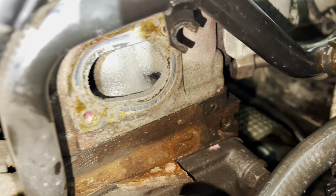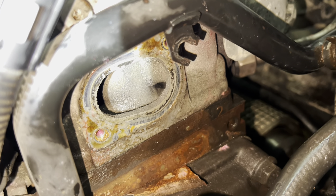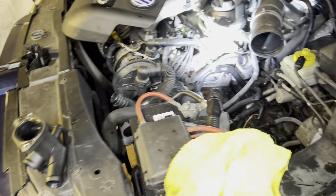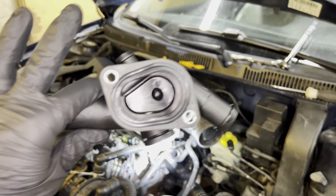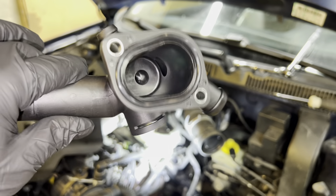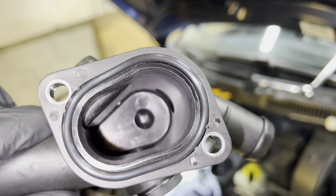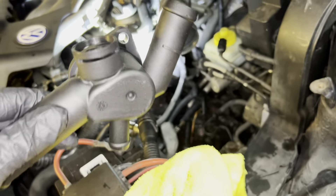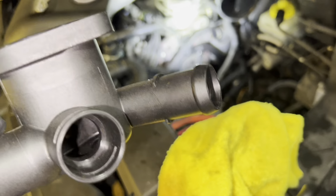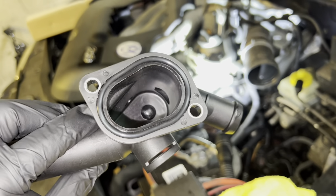Now that we got that out, we need to clean up that mating surface just a little bit. I'm going to do that off camera and then we'll be ready to install the new water outlet. We are ready to install the new water outlet — we've got our gasket installed. Just a heads up: make sure that gasket is in there properly and evenly. You don't want it popping out or pinched or anything like that. So we've got that in there and now we're going to install it — doing the back bolt first because that's a little more difficult. It's very important to make sure that gasket is in there all the way and perfectly.